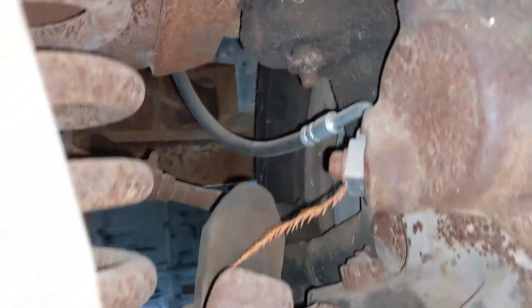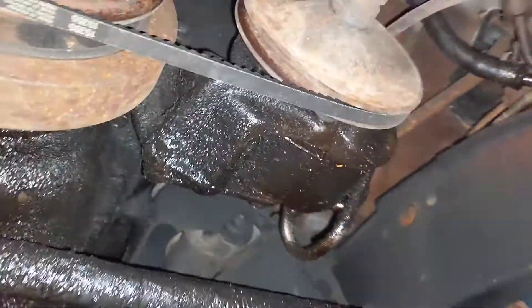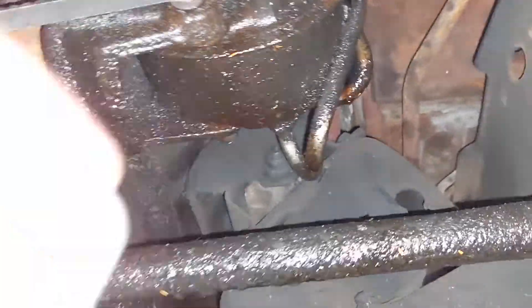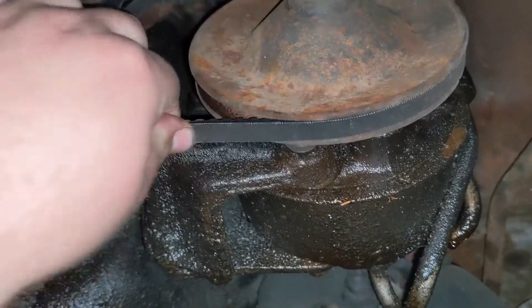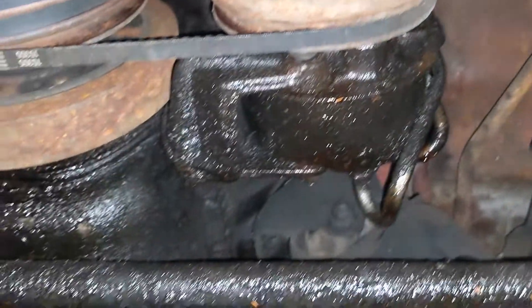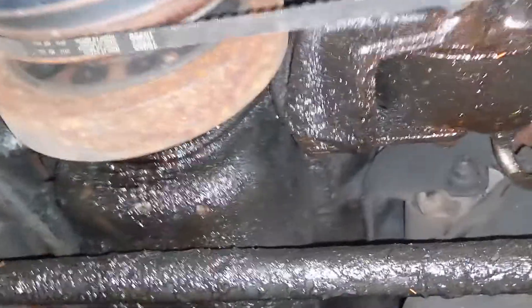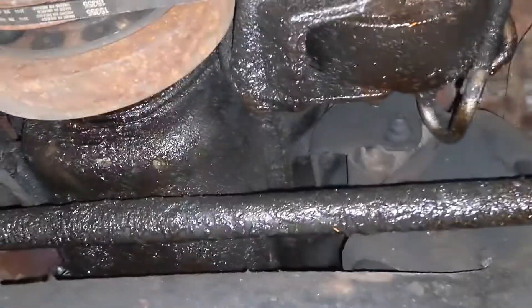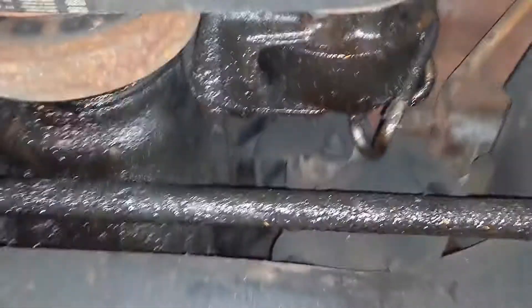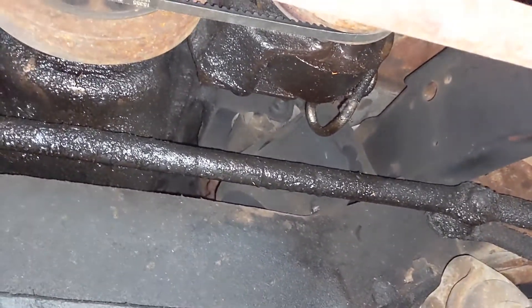This brake hose here I replaced some years ago — that got clogged. There's my power steering pump that I'm just now finding out is going out. I still got power steering, but this is looking pretty bad. This thing is so loose — this belt has stretched out to nothing now, and the tensioner is maxed out. I think this thing has got some really bad play in it; this bolt here is pretty loose. It's leaking all over the place, and that's just making this thing a crustier mess.